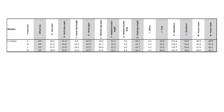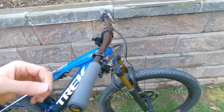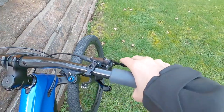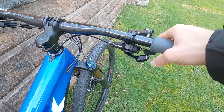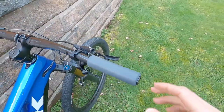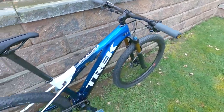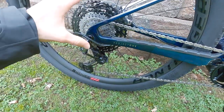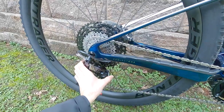For me, this is still premium — I like Shimano stuff. We've got the two-way trigger shifter up here. I comment on this frequently when reviewing bikes. I've got my fingers activating the brake levers and I like to use my thumb to shift. It's two ways so you can use your pointer finger or your thumb — with SRAM it's only push, which is a minor thing. I like that it's got this one-way clutch setup so you can unlock it, giving a little bit of flex for easier drivetrain maintenance, then tighten it to reduce bounce and slap.